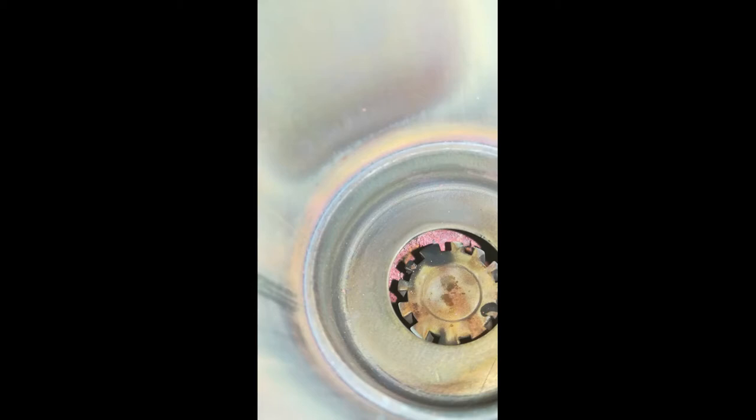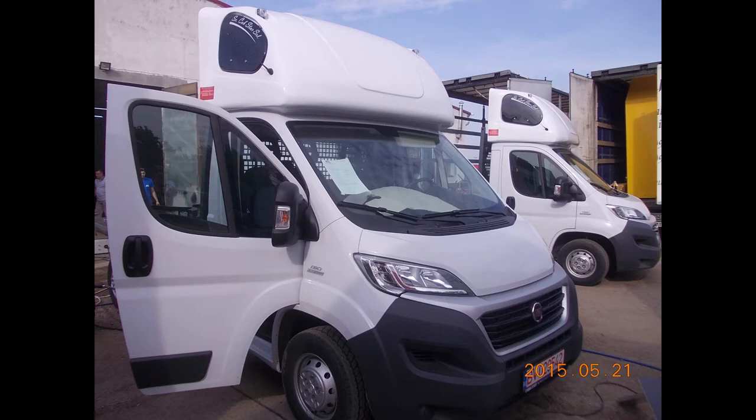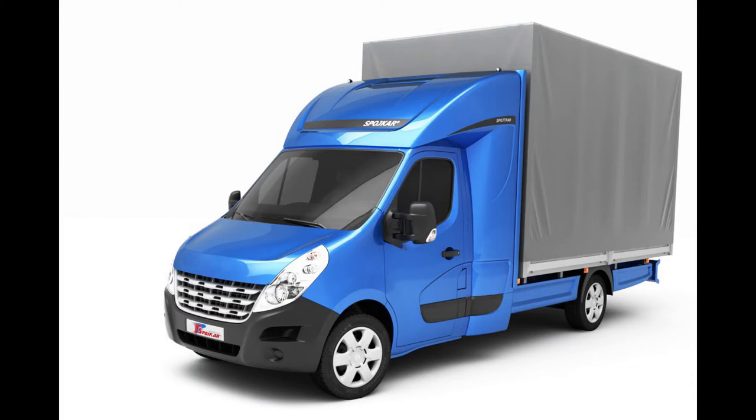If you're asking yourself why this is a problem, the answer is quite simple: the burner never gets to operate at the temperature where all the carbon deposits just burn away. The burner never has the chance to clean itself, and after a time these deposits build up and simply plug up the burner. Nobody makes a heater smaller than 2 kW, so the simple solution is to leave the doors open and operate the heater at max power for at least an hour every week. This problem was almost exclusive to heaters installed in modified vehicles with a sleeping cabin on top, but it can happen in other applications under the same conditions.